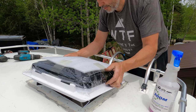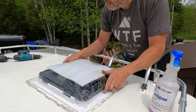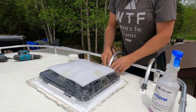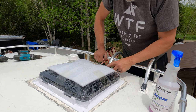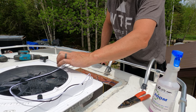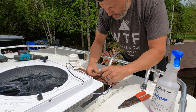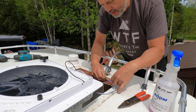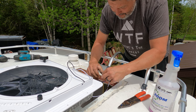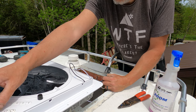Here's our new fan — let's make sure it all fits in the hole nicely before we get too carried away sealing it in. We'll make sure the hinge for the vent cover is to the front, and she fits in there nice — looks like a good fit. The ladder mount is going to go just over the flange here once we get it all in. According to the markings, black is positive and we have blue and white wires, so I'm guessing blue is positive on the camper. Power button — there we go.